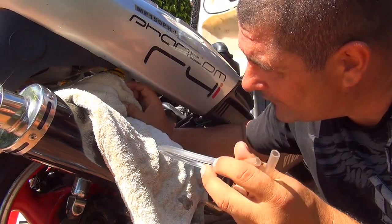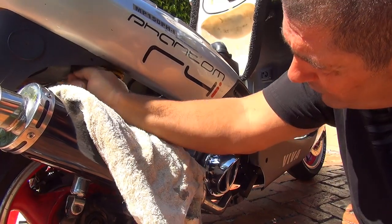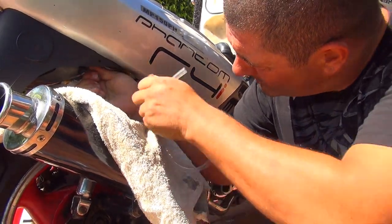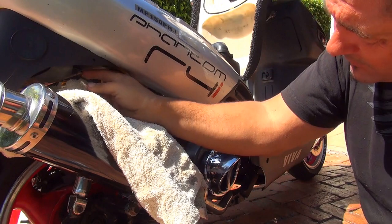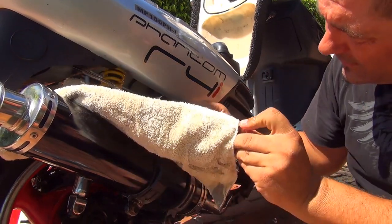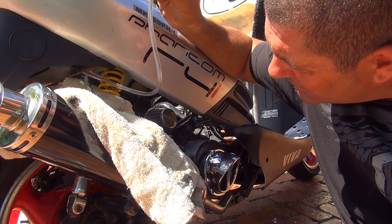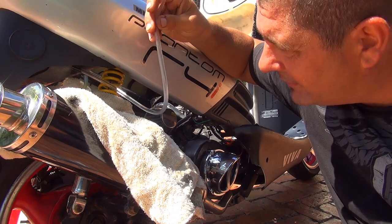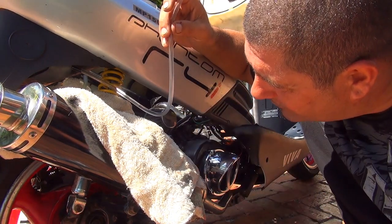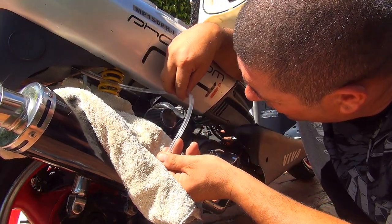Right here you have your 20-inch hose. Pull the old hose from down here — pull it harder and it will come out. Now put the new hose inside there. You might have a few drops of fuel coming out, but it's okay. You can put the container under to catch those drops, or let them fall on the towel you have placed over the scooter.